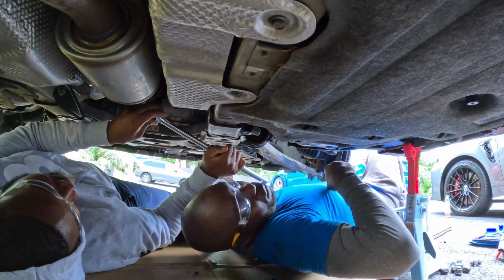Okay, all right, guys. I may have some tools that might work. Oh yeah, I think that's gonna work. We'll be able to get it to 35 foot pound, guys. Yes, I got one. Oh, I feel so much better. Let's try this guy. All right, this one fits. So you cannot use the impact gun tools because they're too thick, but a skinnier one works. All right, guys, 35 foot pound. I'm happy. Now we have to do this guy here.